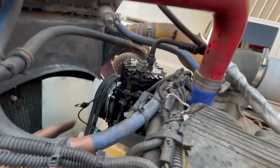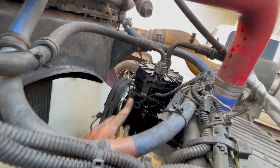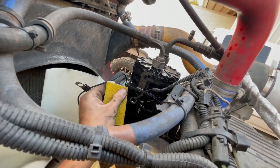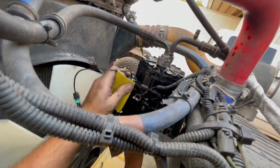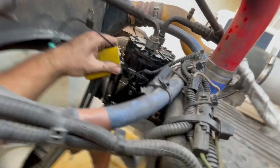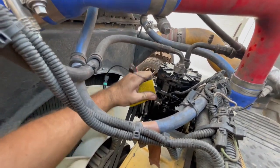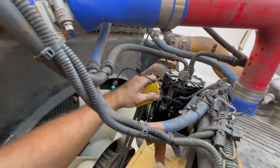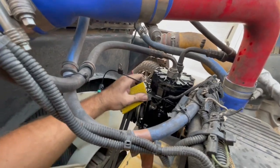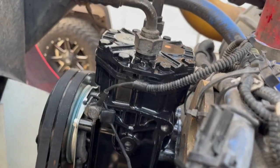This is your ground right here — this wire is going to go here. Even though the inside isn't painted, the bolt will make a good ground, but I still sand it down. The last thing you want is your AC cutting in and out. So I just sand it down, get the paint off, make it nice. You can't beat a nice ground right there — the grounds are on.